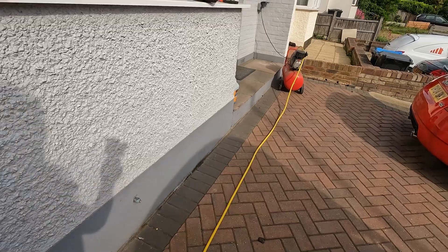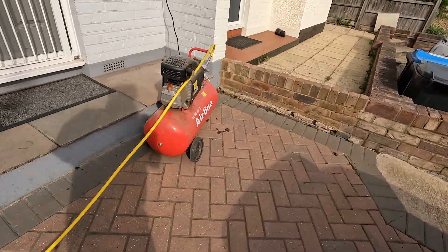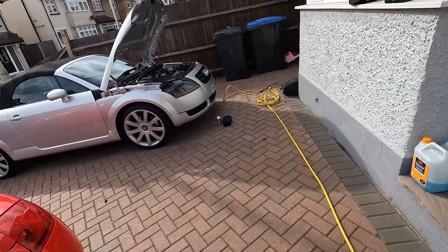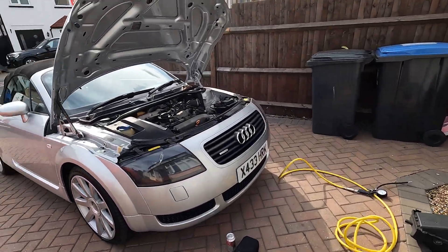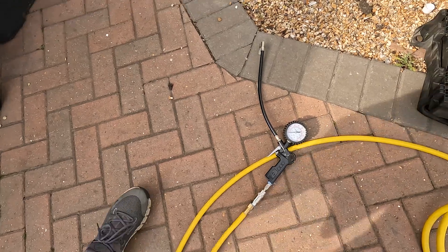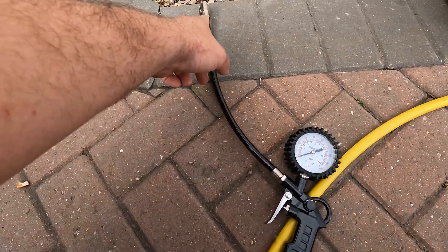I'll quickly show you my setup. I've got the compressor plugged in — I just pinched it from the shed. I've got it set to just over 20 psi. If you know your TTs, when they're mapped they're about 21 psi, and stock they're about 15 psi. But 20 psi they can handle without blowing anything up. You set the compressor low mainly as a fail-safe — if you have it set to 80 or 100 psi and get a bit carried away on the trigger, you could easily break some stuff.